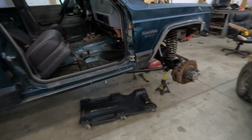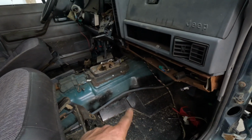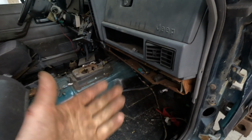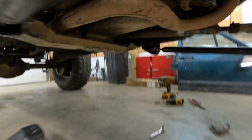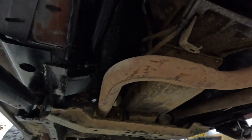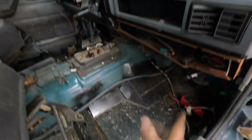We're going to get that back lifted up first, run some brake lines, get all them bled out, bolt the seat down, grind up that, do a little more weld on that. That's where I had to bring the top link bar up inside to get the geometry I wanted out of it. I don't know if you can see up under here, but you can see it hidden up in there. I had to get up in the floorboard to get the heim, to get the separation I wanted on this side. So I built all that out and connected it all in, and then put all this plate in it, it ties all around the unibody that way. We don't have to worry about that.